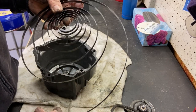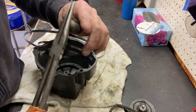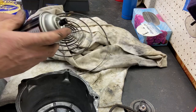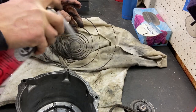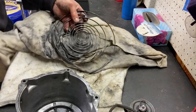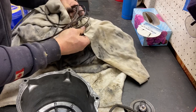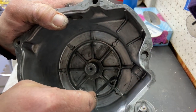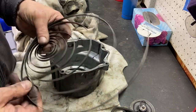That's why my rope was kind of hanging back a bit. So what I'm gonna do is clean this up, re-bend it, and put it back together — I think that's all it needs. I'm gonna clean it with a little bit of trusty brake cleaner, get some of that old grease and dirt and grime off it. That stuff works pretty good. The inside curl — the hook — looks pretty good. You can see it doesn't look that bad. I kind of re-bent it because it's got a hook right in there in that little groove.